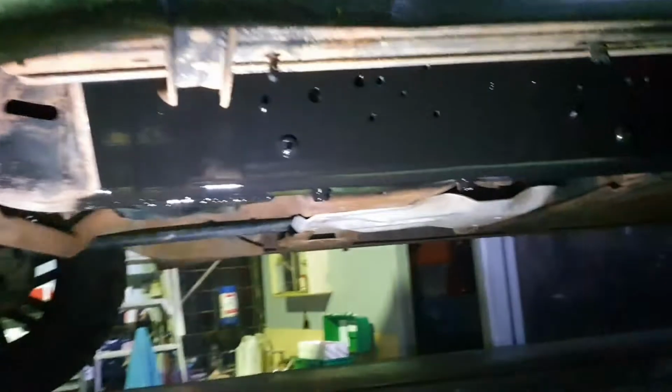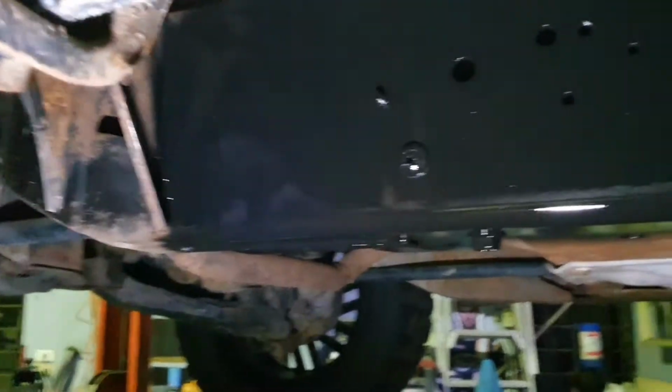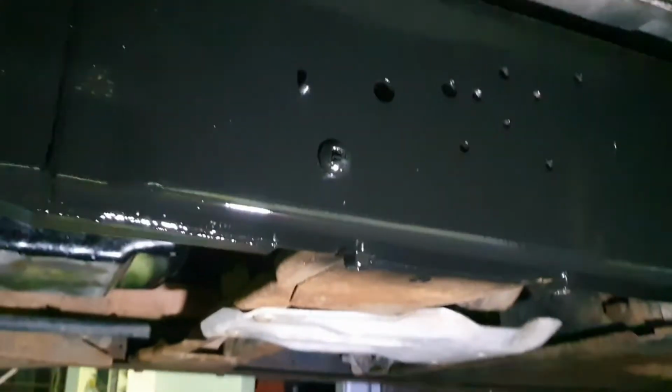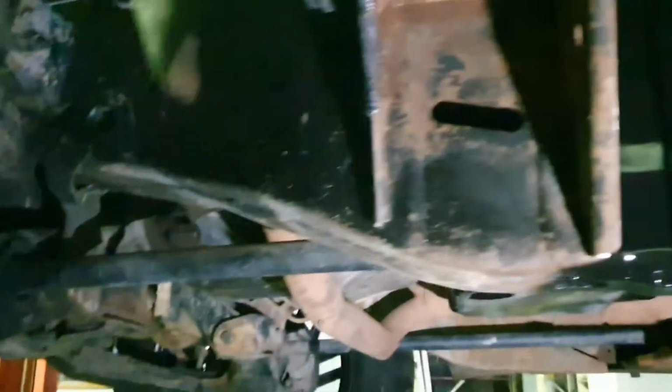So I just did a small section, mainly just to boost myself up. Ooh, geez, she's shiny. So it doesn't take a whole lot, just the wire wheel and the drill, take all the surface out of it. Gosh, she's shiny, reflective too. But the only issue with this car is it's a big car and it's a lot of chassis. I'm used to doing little cars like, you know, Japanese four-wheel drives and whatnot. Tell you what, my short wheelbase cruiser didn't take me real long. So, anyway, that's nice. I can't wait to make the whole loaf look like that.